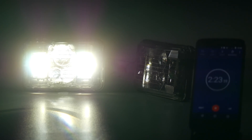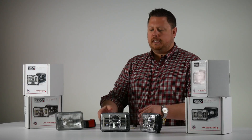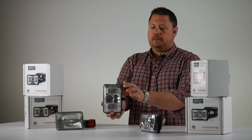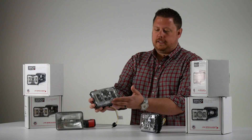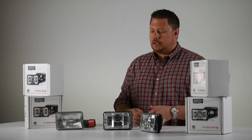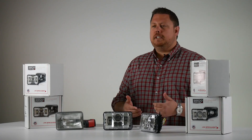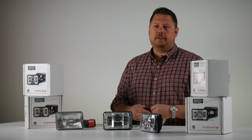At one minute 45 seconds, the light is at an average temperature of 59°F. At about the two-minute mark, you could tell the frosty lens didn't stand a chance. At three minutes, we're pretty much completely melting all of the ice and snow. Before the five-minute mark, both the LED headlight and the incandescent sealed beam both reached an average temperature around 110°F.